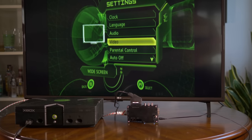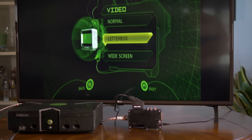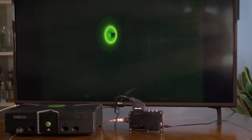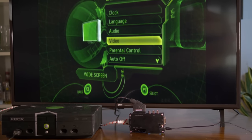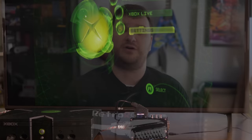This video was just meant to get you started, but there are a ton of options available for the original Xbox, ranging from custom firmware, to emulation, to even forcing certain resolutions through RGB SCART. One quick note about SCART: you can only get a 480i signal with a SCART cable on an unmodified console, and there won't even be an option to enable progressive scan in the menu. Modded consoles will allow you to send sync on green over SCART, which is useful for setups that are already totally SCART-based. All of that is for another video, though.